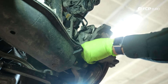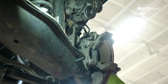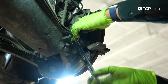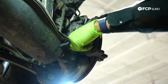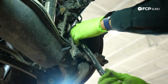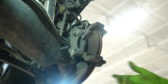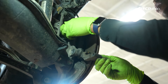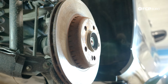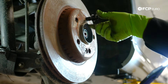We've got two 18mm bolts here that we're going to remove next, which will allow us to remove the brake caliper bracket, and then we can remove the rotor. I'm using an 18mm ratcheting wrench — I don't have much clearance, so once things are loose I'm just going to take it out by hand. The only thing retaining the rotor at this point is this T30 fastener. I'm going to send a lug in here just so that when I remove it, the rotor doesn't go flying.